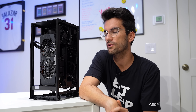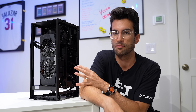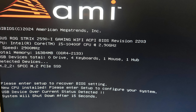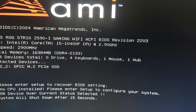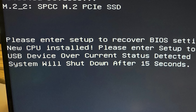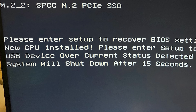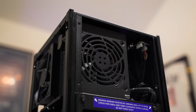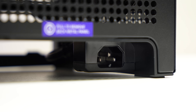I was also informed when the owner met me that most of these components were purchased secondhand. He recently built this system, only to run into this screen here when first booting up. Apparently he can't get past this, and I think it has a lot to do with this warning message right here: USB device overcurrent status detected. System will shut down after 15 seconds. He can't load into, let alone install Windows on, the detected M.2 in this POST screen.